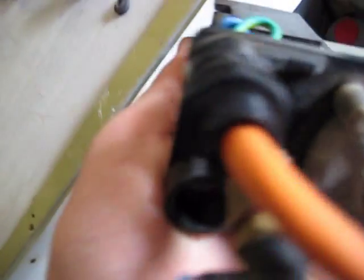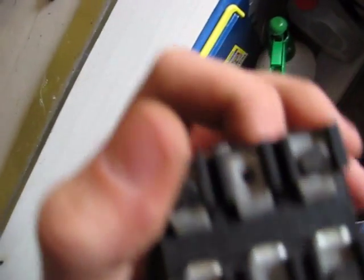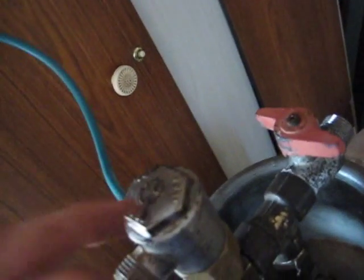That's the finished product. It's all screwed in, it's all sealed up. Got an earth connection, neutral and active on the contactors. This must be the cut out, this must be the cut in side - low pressure side drops down. So there's no pressure on it, so the contacts are closed as it builds up. This is different to most of what I've worked on, so this is the first time I've actually wired it up, and now I've got to connect it up to the valve.